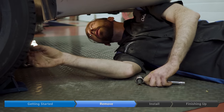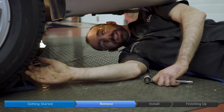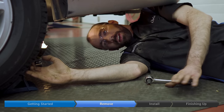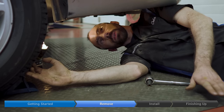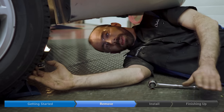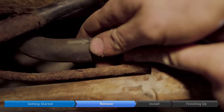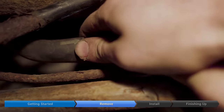There is a hose back here. Look at the area and check for dirt. You want to try to keep any contamination out of the fuel system, so if there's a lot of dirt or mud on the hose, maybe spray it down with a little brake cleaner just to get any dirt out of the way. Once the area is clean, just pull on the hose to disconnect it and it pops free.